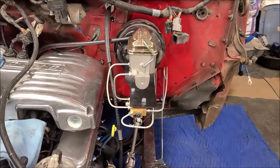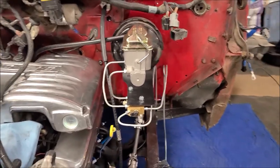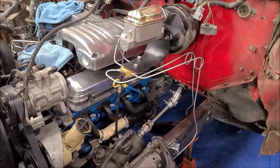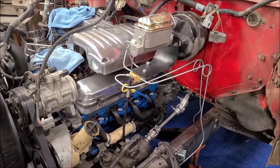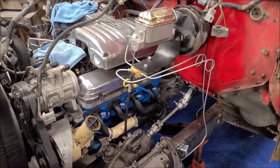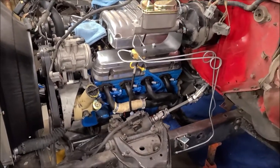I could see this could be frustrating if you forget to put nuts on and cut it too short. But I didn't have any issues doing this from scratch. The true test will be whether the fittings leak or not once I'm all done. The flares look good so I'm pretty confident it won't be a widespread issue — might just be a tightness issue here and there.